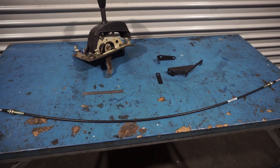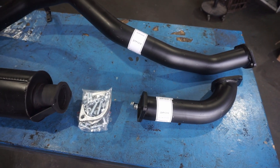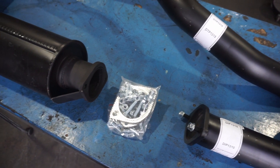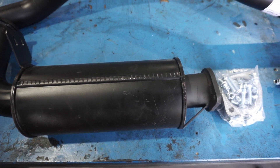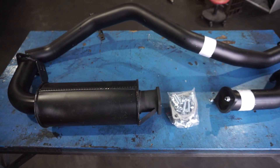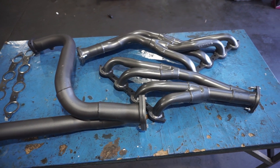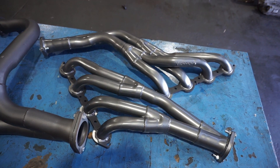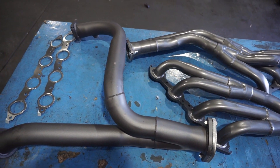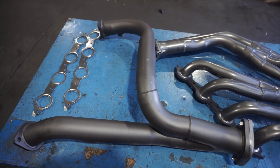For the exhaust we'll be using the same off-the-shelf 3-inch cat-back that we used in the manual video. This kit comes with all the hardware and gaskets. We've cut it off in front of the muffler and welded on a two-bolt flange. The front half is different to the manual — this is the mild steel variant for automatics. The extractors themselves have a different outlet location than the manual variant. It comes with a Y-pipe but it doesn't suit the 6L80, so we'll have to modify that slightly. We'll also be using MLS exhaust manifold gaskets.